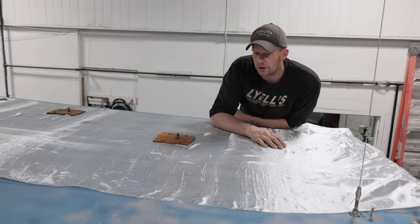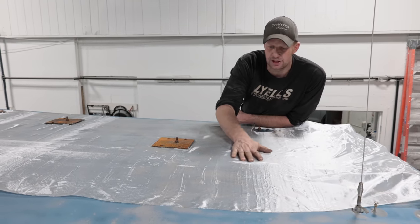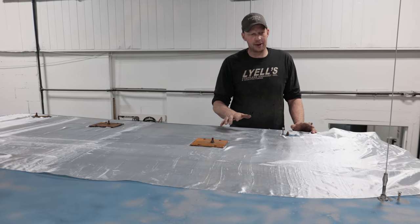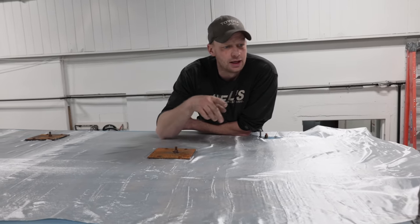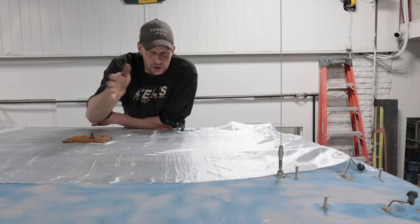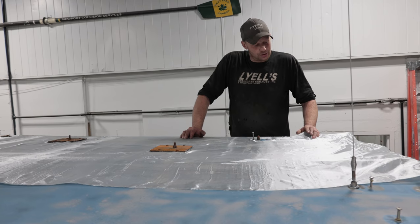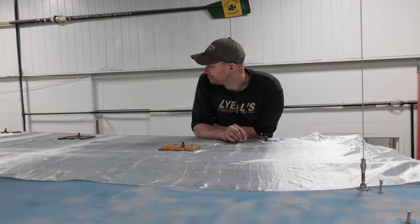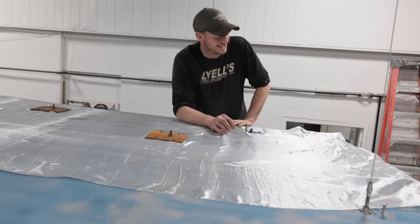Well, talking it over with Industry Garage, came up with the best solution to fix this roof is to put another fresh layer of fiberglass on top. So we're going to put the resin on and then lay the mat and then put more resin on. The issue is these plates are in the way and the lights, so I got to cut around it. So roll it all up and unroll it like we did with the Audi, which seemed to work okay. We'll try that. We're going to cut all the holes out of it first, just because it gets really, really messy. Kind of get one shot. I hope this works. The first time trying this, but see what happens. Here we go.